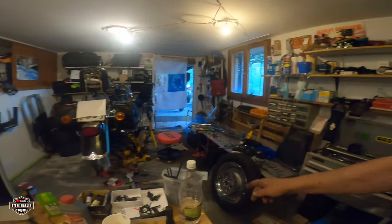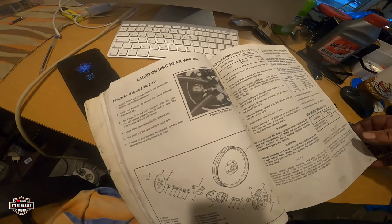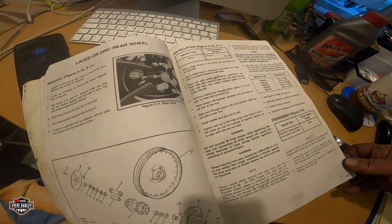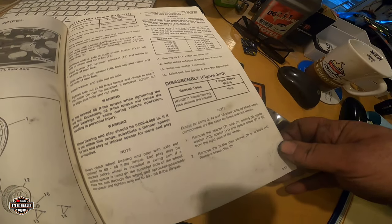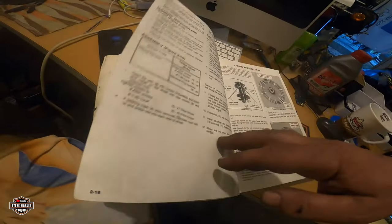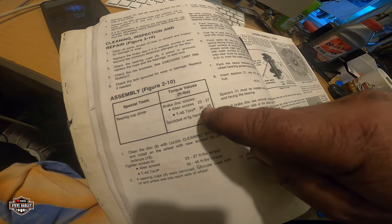All right. I have to tension the T45s on the pulley because I put Loctite on, so I can't leave it overnight. So I will scan this page here, and put it on the book so you have it. Okay, this is for the Fatboy Softail. You can see the pulley here and the numbers. And on this page, it's T45 Torx, that's what the pulley bolts are, 30 to 45.